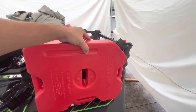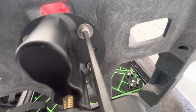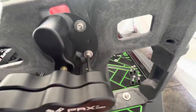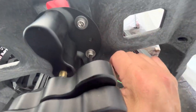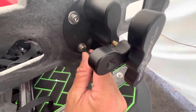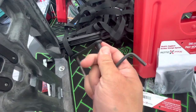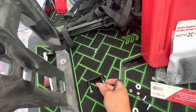These are M6 316 stainless Allens that I sourced locally, and they do have washers. The washers I purchased are a little bigger than I would have liked, but the hardware store didn't have any smaller ones in 316 stainless, so these will work. You can really customize the hardware however you want — it's not included with the Rotopax bracket or with the Kawasaki rack. The only things included are the base mounting assemblies; you have to source your own M6 bolts.